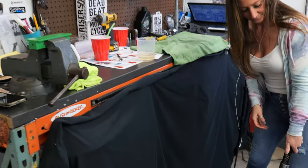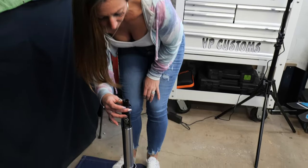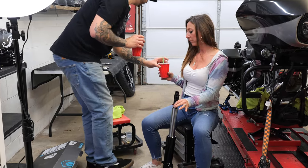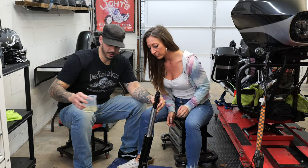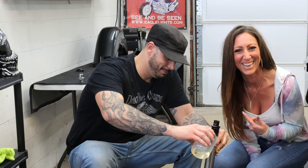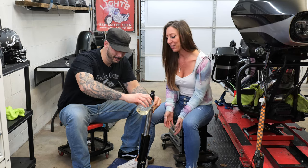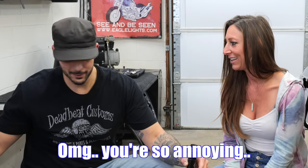This is going to be a little strange guys but we're just following the directions. Four and a half ounces of oil — this is where it's going to get time consuming. You have to pull the fork cartridge away and literally just drip it down there. This is a very important part of the process. This took a while. I already knew she was going to have no patience for this — I'm surprised he let me go through this whole part without jumping in.